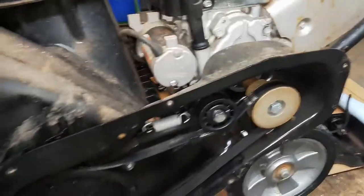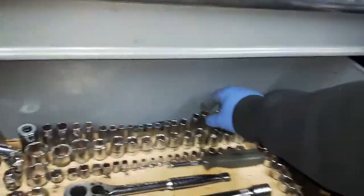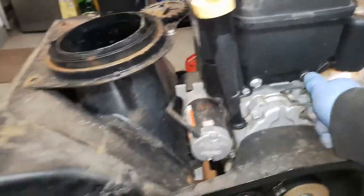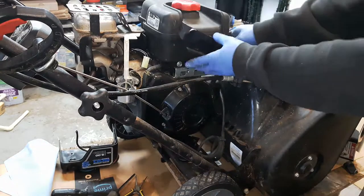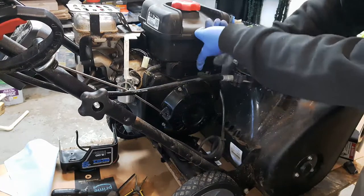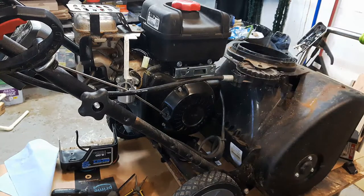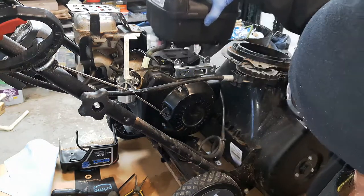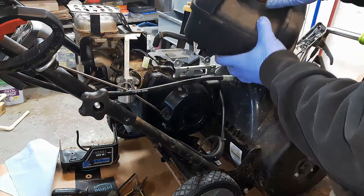Looks like there are two bolts on this side holding the fuel tank on — looks like a couple of three-eighths, maybe a seven-sixteenths. Nope, they're metric. Of course they're metric — probably 10 mil. I'll zip these guys off. There's also this little plastic molding with two bolts on here and one bolt on the backside. Take that off, it exposes two more 10 millimeter bolts, and then the tank should come off. There you go guys — that's how you remove your tank off one of these Craftsman 922 snowblowers.